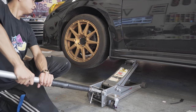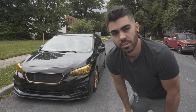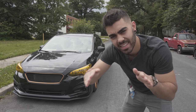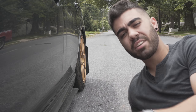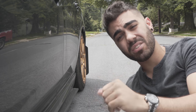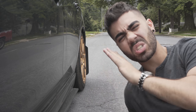We loosened the camber plates. A downside to these BC Racing coilovers — they don't give you much camber. This one's already fully adjusted and it still looks pretty straight to me. So Senpai helped me adjust the camber and I'm a bit disappointed. You know those cars that are super stanced with the wheels coming out like this? That's what I want, but the camber plates on the BC Racing coilovers are just not what I need to get that outcome. This is the natural camber that comes with the rear BC Racing coilovers — there are no camber plates on the rear. I'm kind of happy with that camber though; it's not super aggressive but it's just enough to give it a little slam.